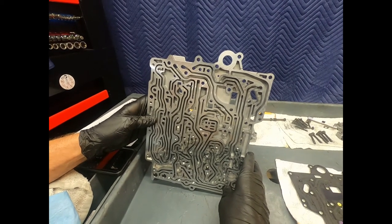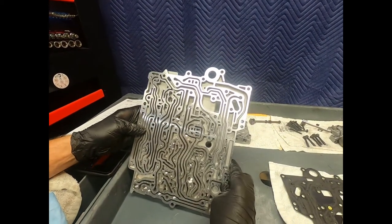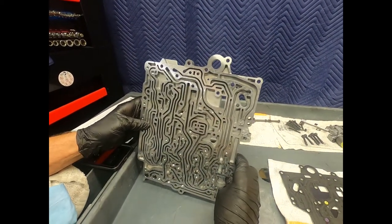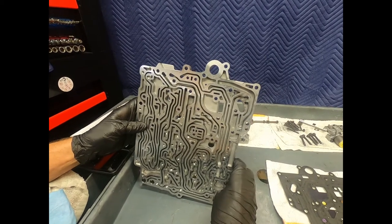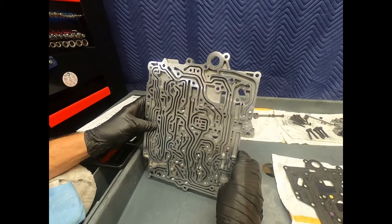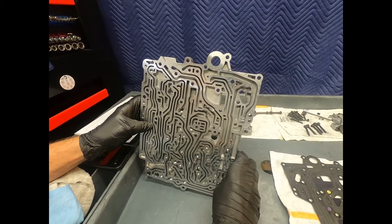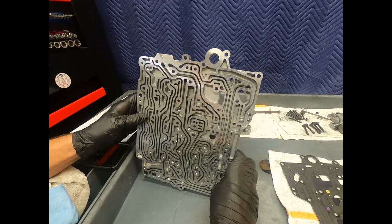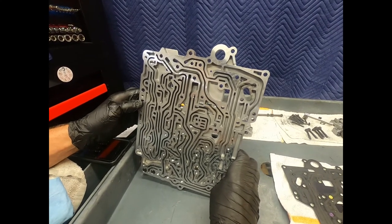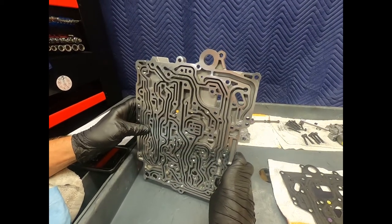Now, I use the 105 solvent. It's the more volatile solvent. It dries pretty well. When it's fresh, it dries very quickly. After you contaminate it with transmission fluid, of course, the residue of the transmission fluid remains, so it's not quite as good. But then, of course, after 90 days, the Safety-Kleen man comes and changes both my solvent tanks.